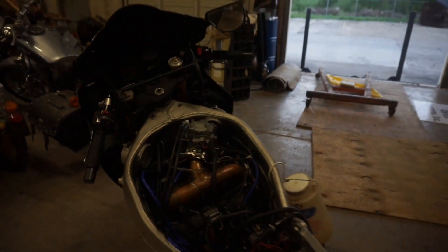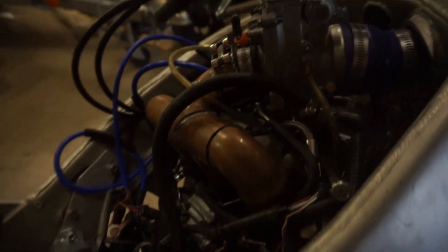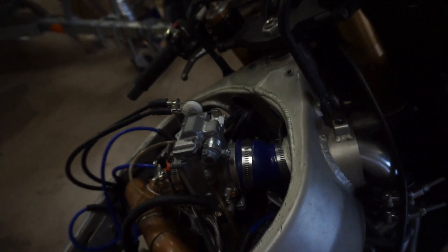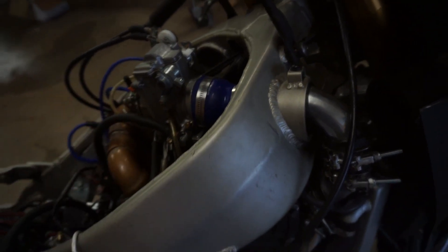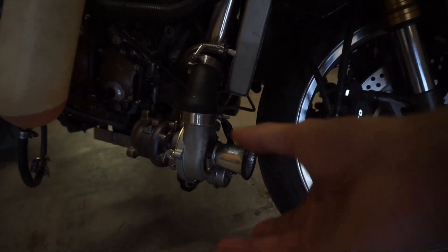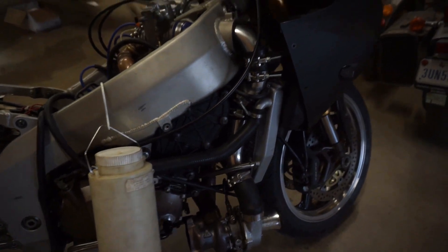Here's the intake. It's all copper - my dad sweated it with rosin and soldering wire. Came out really good. This is the carburetor we're running, the 42mm HSR flat slide. And here's the turbo. Like I said, we just changed it going directly up rather than running across and up and then back into the carb. Just a lot shorter routing this way.